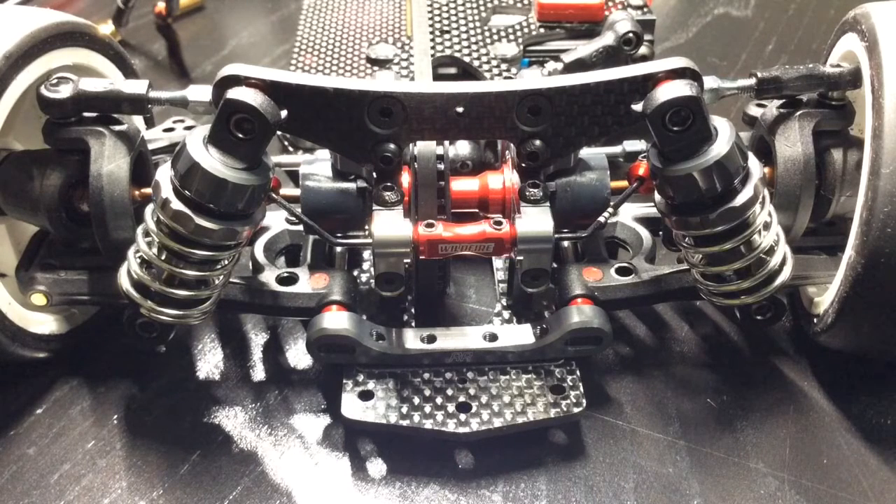Sometimes it's almost the equivalent to changing a full spring rate. The great thing about changing the shock angle is you can do it quickly through testing. Take your car out on the track, do a few laps, see how it handles, and if the setup isn't to your liking, quickly unscrew the upper shock mounting position and go up or down one hole — that will definitely give you a different spring rate and feel.